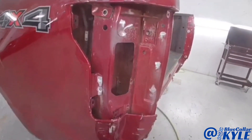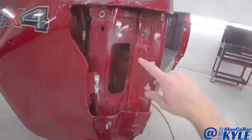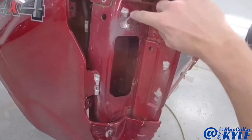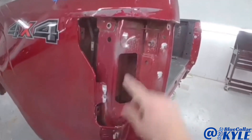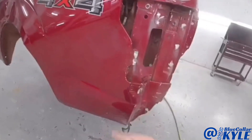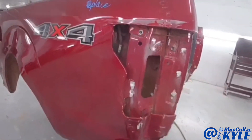A lot of people have asked me: if this is aluminum, why are there sparks? Because aluminum doesn't spark. These self-piercing rivets, which they use to put these panels together, are actually steel — that's what you're seeing spark. It's the self-piercing rivet, not the aluminum, because aluminum does not spark. That's why you see sparks, but this is an aluminum panel.